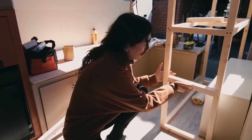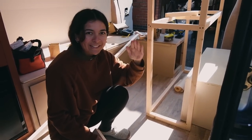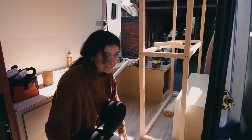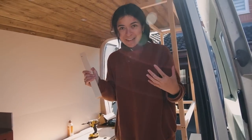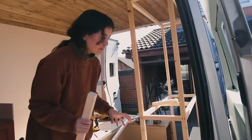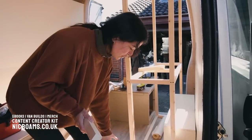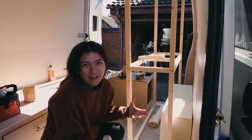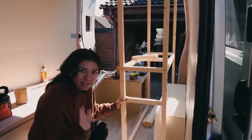We're now going to add another strut in here — this bit is going to be the bathroom. We're going to have a folding seat in it because it's going to be so small, about 50 by 60, you can't move around too much. Our friend suggested putting a seat in there so you can sit down, use the hose lock and shower yourself down. We measured the backs of our legs — that's what Google said to do to find the right height. Mine's 50, Sam's at 53, so we're going for 51 height. The seat can then be screwed into that and be nice and secure.